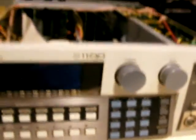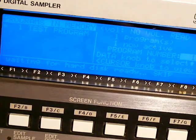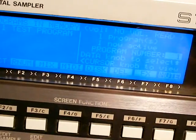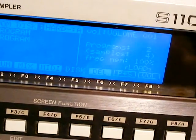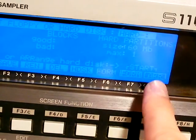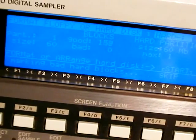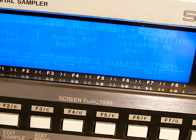Now we're fully plugged in. Turning it on — 'waiting for hard disk' — and that came up much quicker this time. I hit disk and you can see that I have programs here, which is what you want. Before I had programs though, I needed to hit disk and format. It will give you some prompts, but ultimately you want to hit 'arrange' — not 'format' — to format the drive. It says 'destroy all hard disk data, yes,' and it starts looping through all the blocks on the drive. Hopefully you'll get the same result I got: no bad blocks. At that point your drive is formatted.